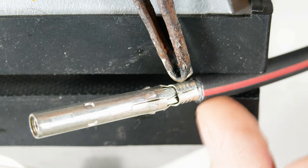With the negative female side it's almost exactly the same thing. Make sure the seal is in place, the nut is ready, insert, and press until you hear the click — there, snapped in place. Tighten it down until you have a good seal at the back, and check to make sure the contact is in position. The negative side is ready to go, and that's all there is to making good solder joints for solar connectors that will last a lifetime.